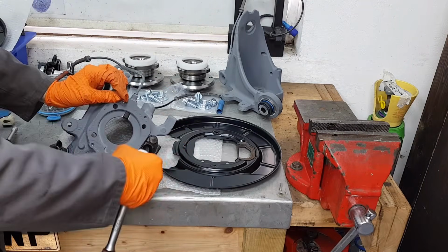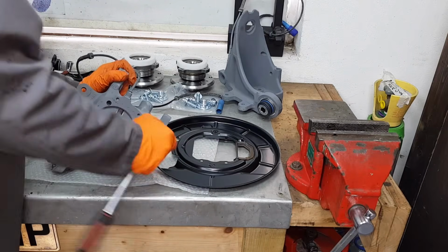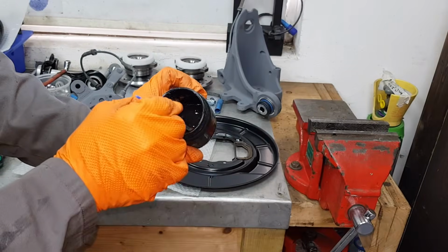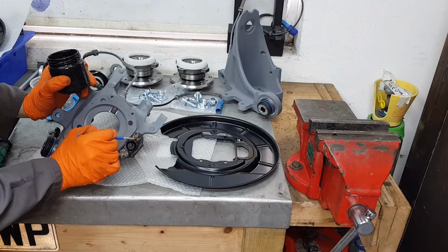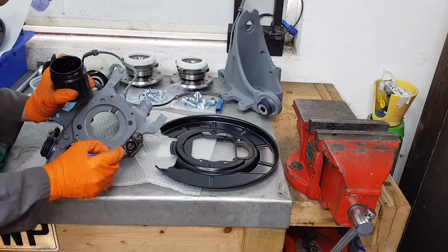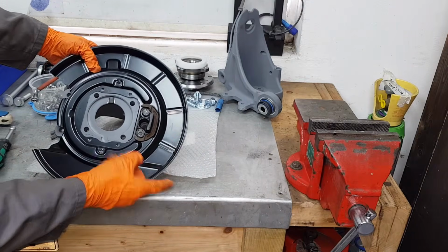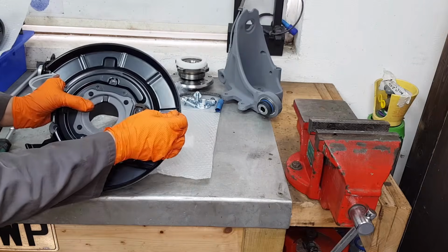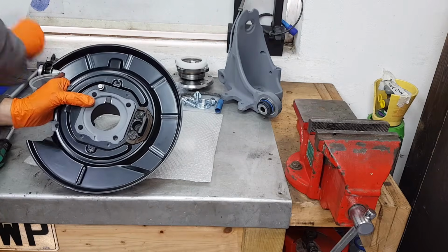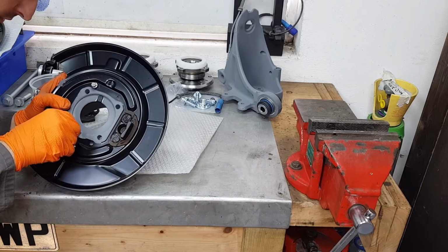This is a 16mm bolt. This is water-based rust converter. So we're gonna paint these bolt heads. I'm gonna install upgraded stainless steel marine grade bolts. I doubt this will ever have to be removed, but just in case. And you wanna install these bolts in place by hand because you don't want to cross thread them with the tool.